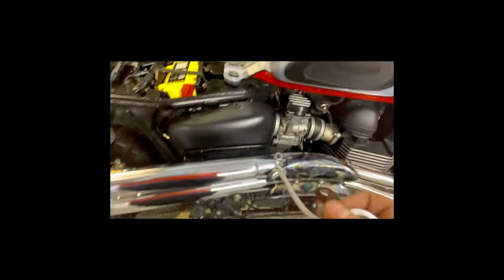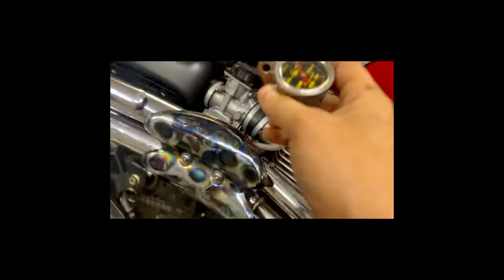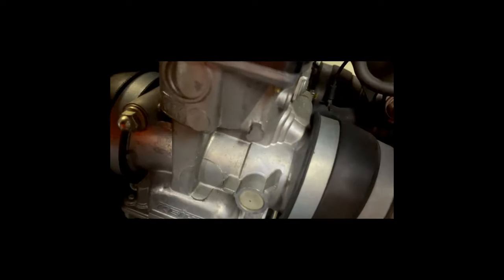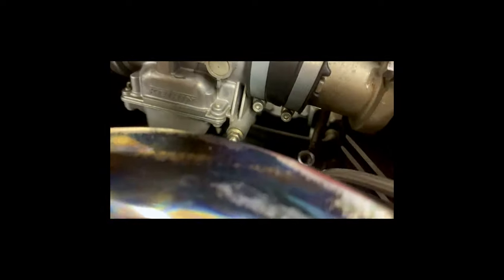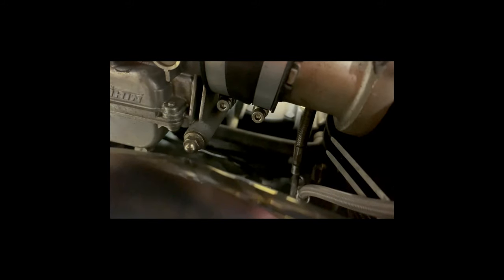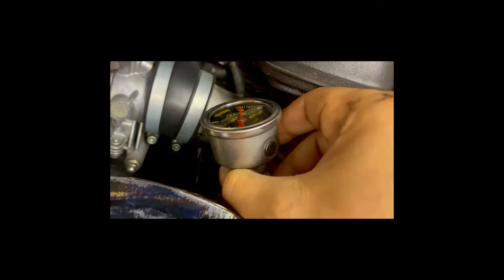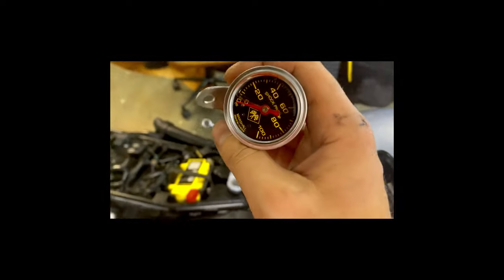Alrighty, let me tell you what's next on the docket. We're going to put this oil pressure gauge in here. I kind of want to show this because I figured it out and I don't think a lot of other people show this online. So this banjo goes into that right there. It's another oil pressure hole right here on this line, and then a long bolt goes through and you put them both in with crush washers. Then here on this stud is where this sucker goes in. I'm going to install it and then maybe give it a kick and see if it works.